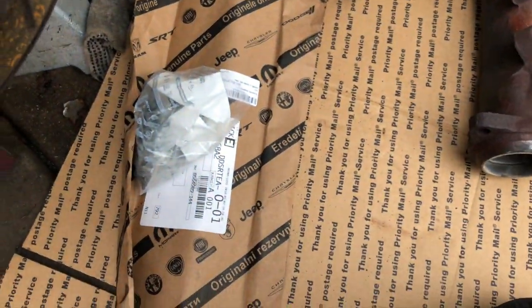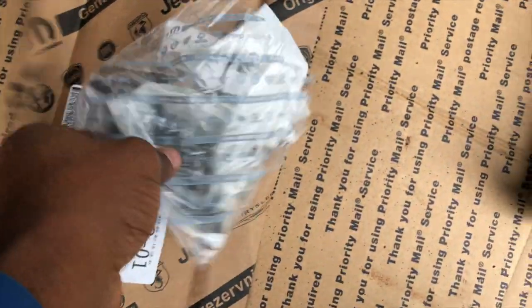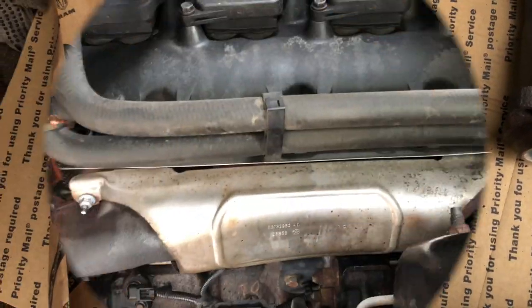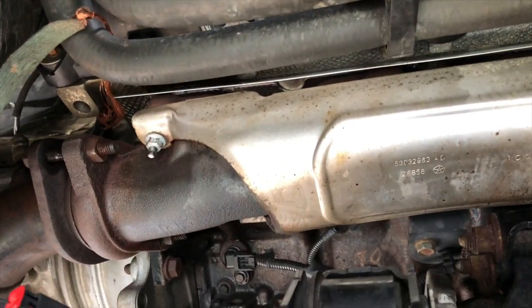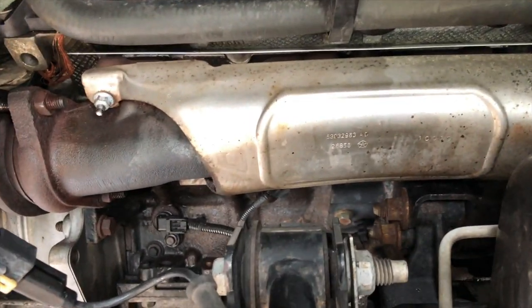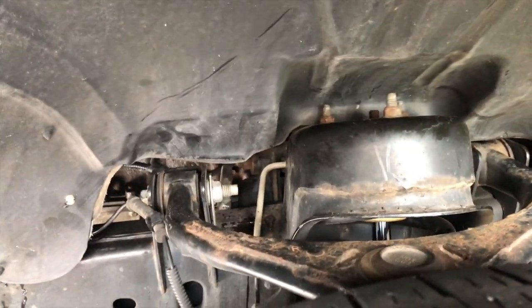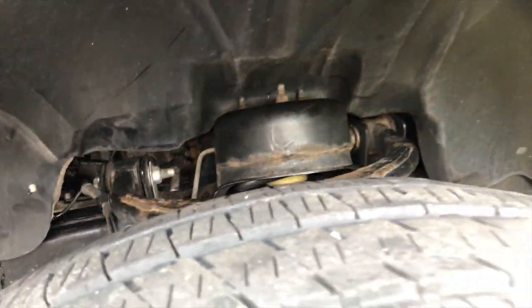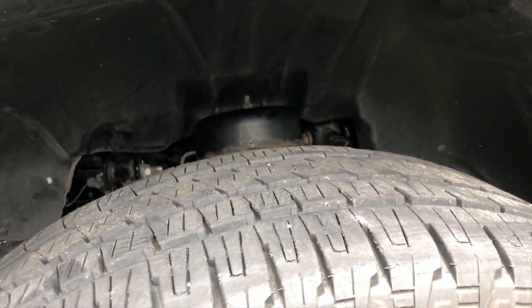You want to have a clean mount between the manifold, the gasket, and the head. So use a wire brush, get that manifold cleaned up, rag wipe it down. And I recommend — I know it's a few extra dollars more — but use the OEM hardware. It's worth it. No more noise guys — truck sounds super quiet, I haven't heard it this quiet in months.